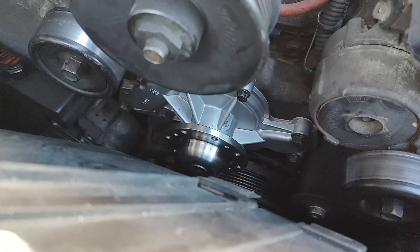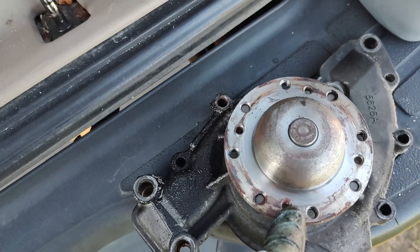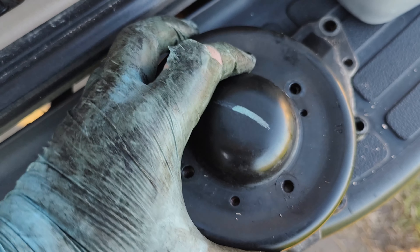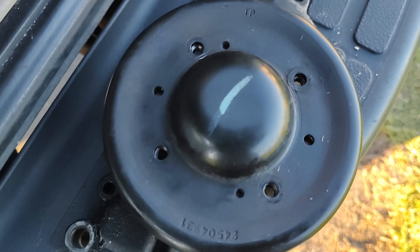Got that back on and torqued down. I'm going to get the power steering pump back up and get that pulley back on. I'm using the old one to demonstrate, but you do have these dimples right on here and these extra holes right here. If you line it up in any of those holes, you should feel it pop into place once you get it right.